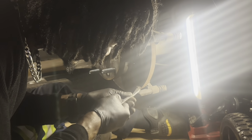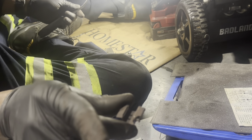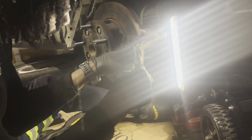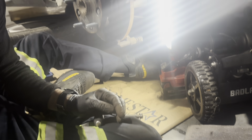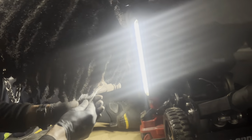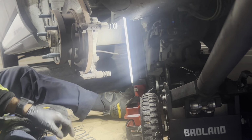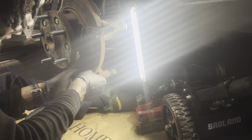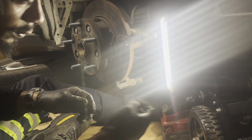As you can see, it's got the lip that I'm talking about. And then we're gonna remove the top. No lip. All right. And even though we're gonna take this caliper bracket off, I'm just gonna go ahead and put these clips, have them seated so they'll be ready when we go to install them. One of those things we gotta do, even though we're gonna take it down.